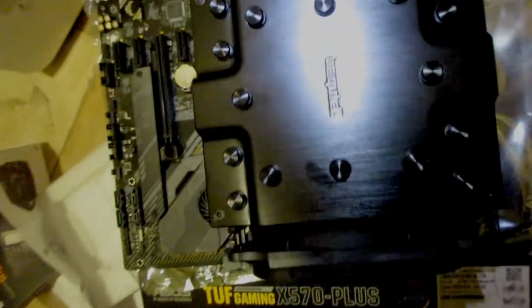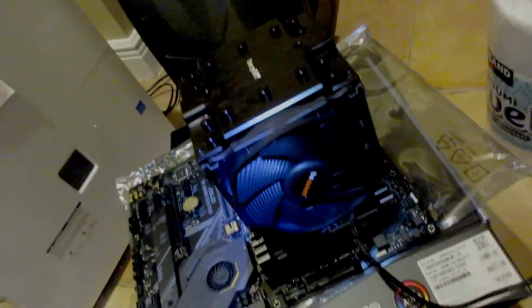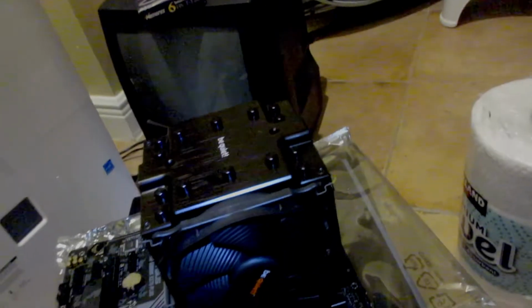Alright, the heatsink paste seems to be nice. No overflow. Possibly we just put just enough. I don't know. Less is best. And now let's go bolt it down. God damn, this thing is huge. Yeah. Tighten, it's kind of cool. Center fan has to be removed, and then you just kind of stick your screwdriver down the 2 holes and remove those plugs. Let's do it. Like that, dude. Let's go do the other one, dude.